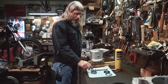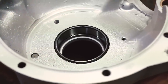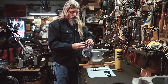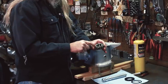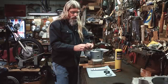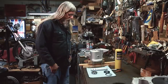When it's time to put this bearing on the crankshaft — when we're getting ready to put the crank in the cases — pay attention to which way it goes. When it came out of the race we just installed, this side was facing up. So this edge will be going in. If you notice on this side, it's got this little portion of the cage, and it also has the part number on it. So the part numbers are going to face out on the crank — this will face in. When it's installed, it'll go in the crankcase like this. Just pay attention to that — don't want to turn it around the other way.